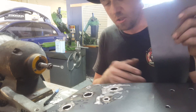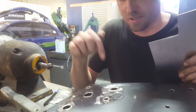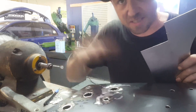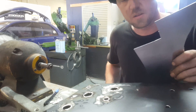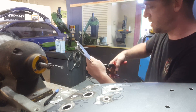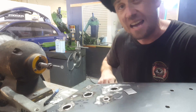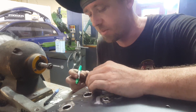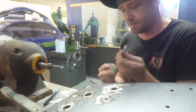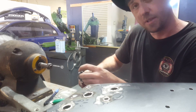Using slightly thicker metal will give us more time for both pieces to heat up and get a good dab in there to hold it in place — which is exactly what we want, and why we build up the edges. It's also thick enough that we can take all of this metal back down, make it nice and smooth and clean, and you'll never even know the hole was there. So we'll grab our snips, cut a small piece — just a tiny little section. If you had accessibility behind there you could trace out the circle, but since we don't, I'm just going to sketch out roughly where I need to cut and slice that shape out.